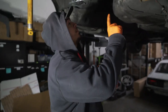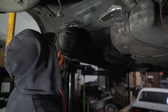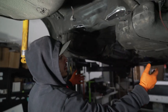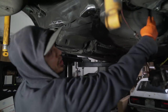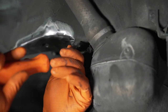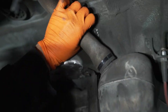Now that we're at the bottom, I'm gonna start with the filler neck hose. What I'm gonna do next is remove this bracket first just so I can support it properly, then remove the other two brackets and lower it a couple of inches so I can get to the hoses that are on this upper corner and on the same opposite side as well. That's loose already — I'll just leave it there for now and once I start to lower it I'll pull it off all the way.